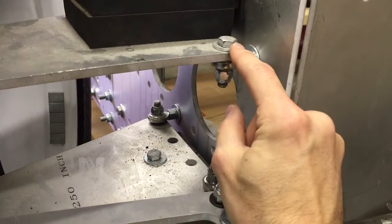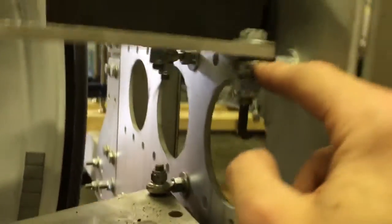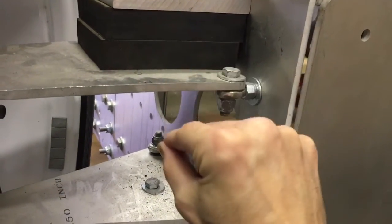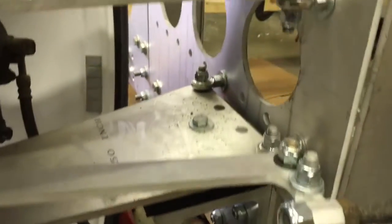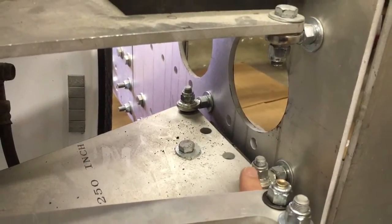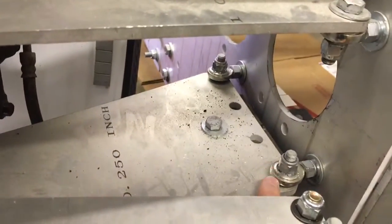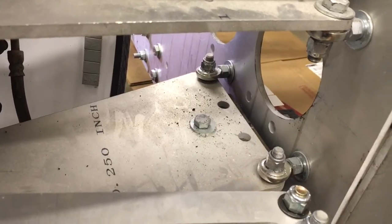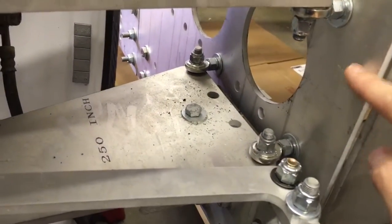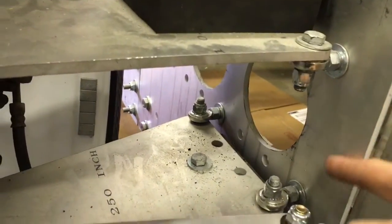There's a washer on top and we don't need a washer on the bottom. Note the bolts go down, because if you had the bolt going up, this would put the arm in a different position — it actually wouldn't fit. Same on the bottom. So the spherical rod end bearings are on the inside of the A-arms, in the very front hole and the very rear hole of the A-arm.